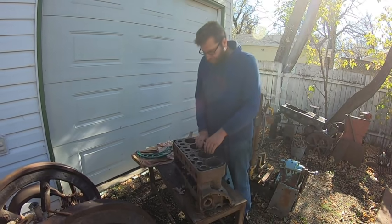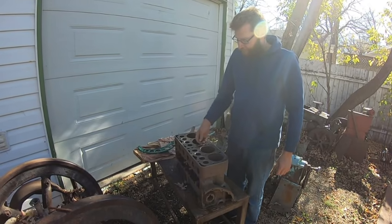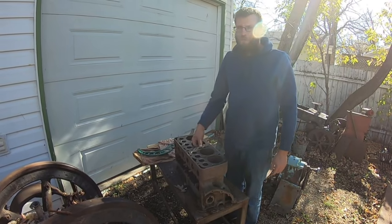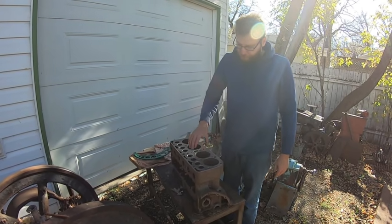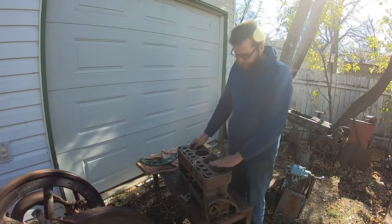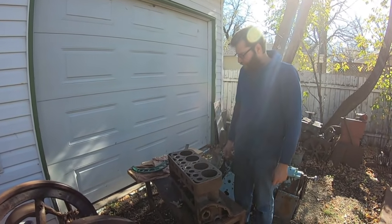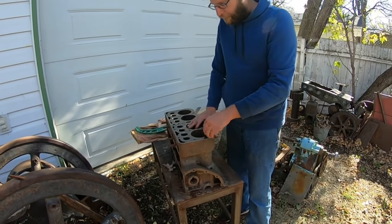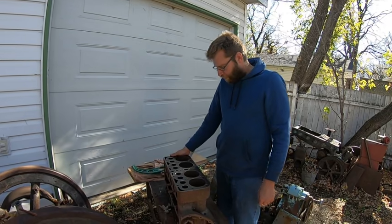I think that's going to be the next thing — there's a fair amount of ridge on there. The question is: do you put your boring bar and center on the non-worn part or the worn part? I'm of the opinion you do it on the non-worn part because that's back to your original datum. If I had a block really badly worn I think what I would do is just set up in the middle going for a bit just to clean up so you know where your true datum is. This one I might even try to bore out for the mains and put insert bearings in. I'll probably make a proper hold-down bar — for right now I'll just try the one with the rod on and see how that works.